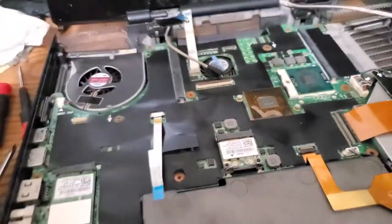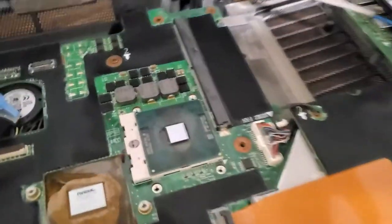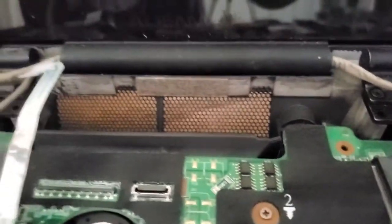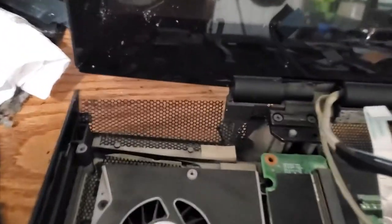Just got back in from outside. I used some compressed air to blow all the chunks out of this. We're not going to go for squeaky clean because I don't have the patience to pull the motherboard and all the other components out, separate screws, and clean things up with a toothbrush and some rubbing alcohol. But I do have the time to blow out the chunks. That just sounds gross. Blow the chunks out of it and make it a little more presentable. The airways are clear, the fans are clean, and the CPU is going to be much happier not being bathed in thermal compound and a fan that is completely stopped up with dust and dirt and debris and cat hair and Cheeto crumbs and whatever else was in this poor thing.